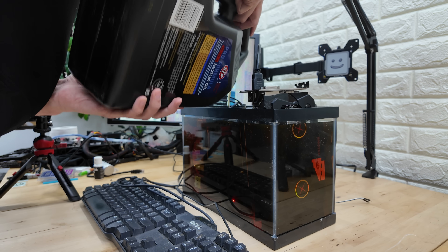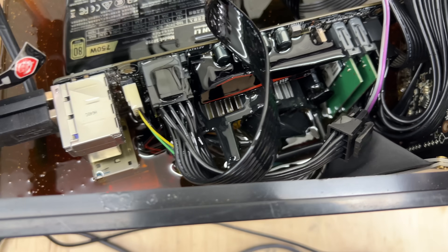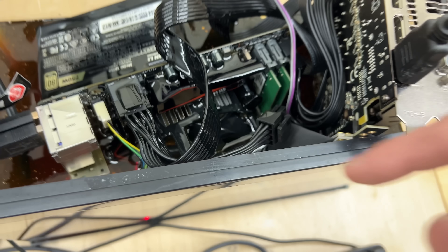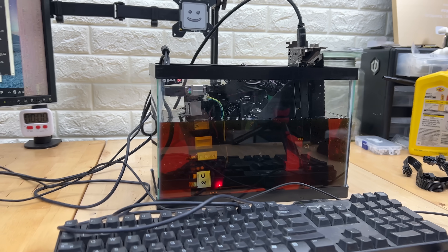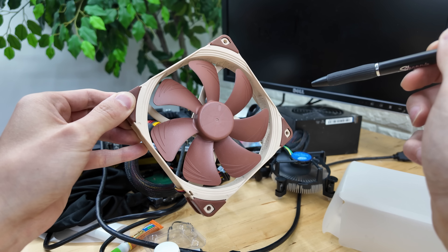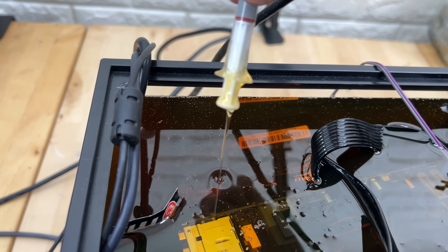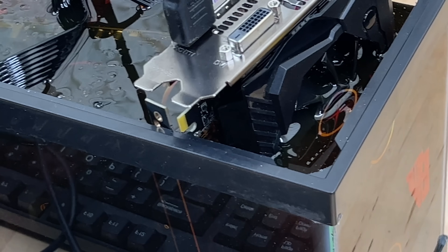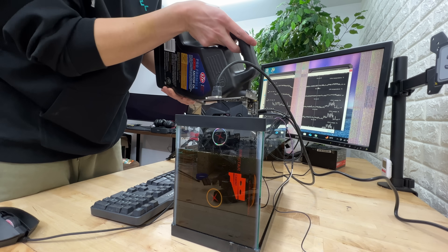However, as the oil begins rising higher and higher in the fish tank, we do start to notice something peculiar. Take a close look at the fan covering the CPU. As the oil begins to overtake it, the fan almost immediately stops spinning altogether. Every once in a while you'll see it sort of spurs to life for a little bit, but this is actually the fan's safety mechanism at play. When a computer fan is interrupted, like by hitting something or having something jammed inside of it, the motor will stop and wait a few seconds before spinning back up again to try again. In our case, the motor oil is so viscous that the added resistance is enough to trigger this pause mechanism. You can see the same thing happening on our GPU as well, meaning that within this oil, our fans are effectively not effective.